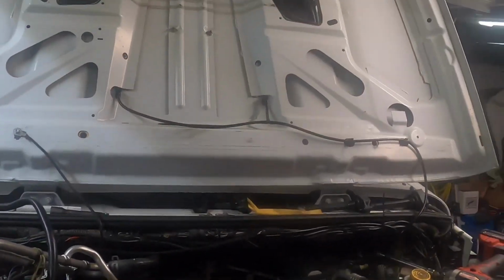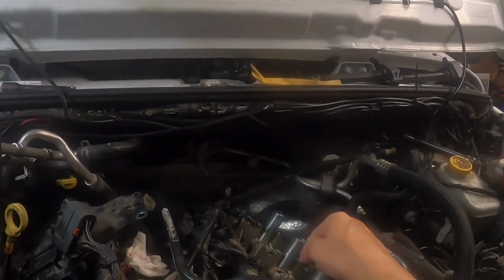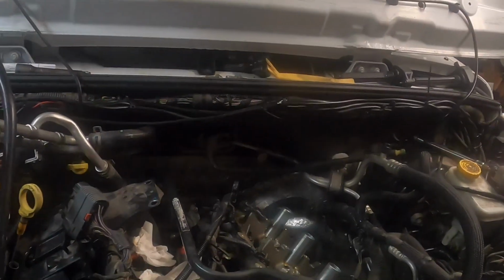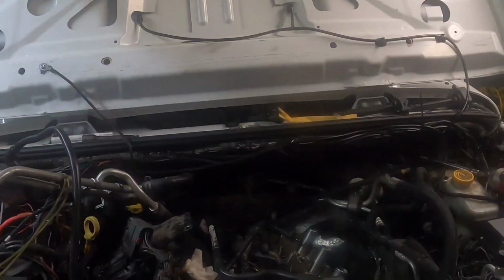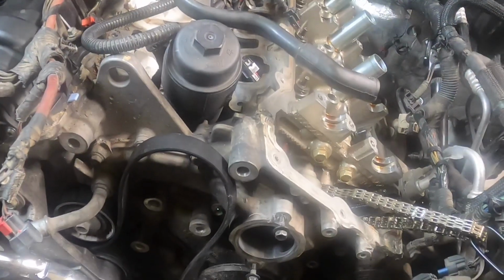And like I say, once we do it, we'll just rubber mallet it a few times. Make sure, because you got two dowels on it. Mm-hmm. And it should just pull right off. So you just got to get those four bolts off the AC compressor and pull the head bolts out. She should come. Beauty, that's for damn sure.